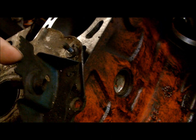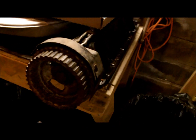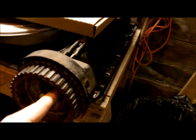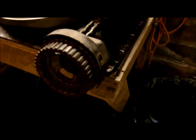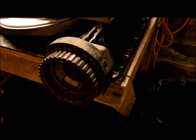The way you set the timing on these motors for cam timing is you line the mark to top dead center, which is right about here on the crank pulley. Then you wander over to the cam setup — the cam carrier that Chevettes have has a little hole in the pulley, and you line it up, put a nail through it into a hole in the cam carrier sheet metal. When you do that with the motor at top dead center according to the timing mark, everything's set.